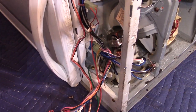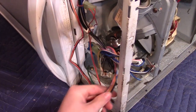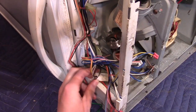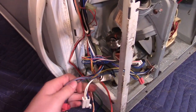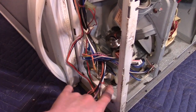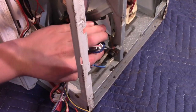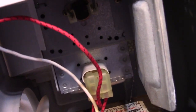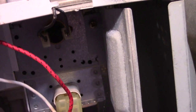There's a whole bunch of tangled wiring here — it's all looped around. There's another thermal switch here on this piece of metal, and there's actually another one over here. There are two more wires running along going down to yet another thermal switch. That one is directly on the magnetron.